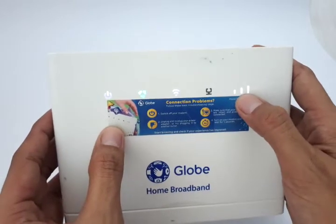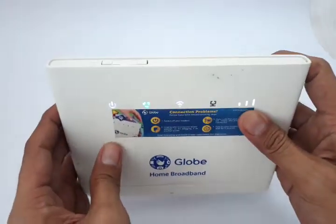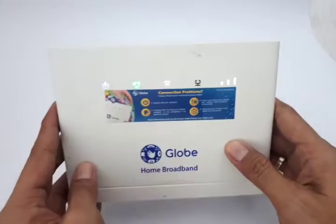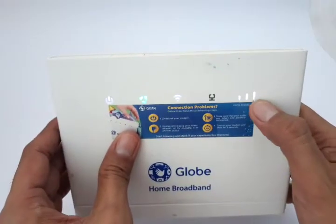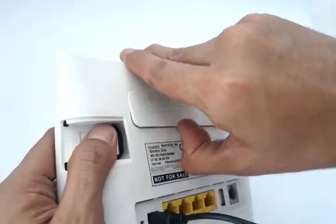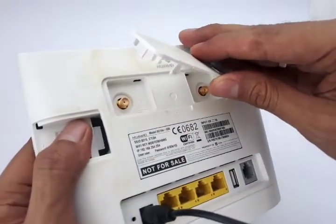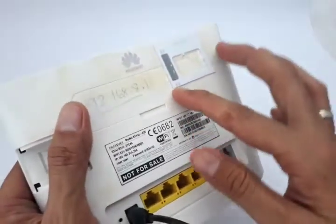When the signal lights are not present, you may need to relocate your modem to a place near your windows or doors so it can receive signals from the network. Better yet, you could use an external antenna — just open this and you'll see two SMA female connectors. The antenna is very cheap, around 200 pesos each, and you can use that to boost the signal.